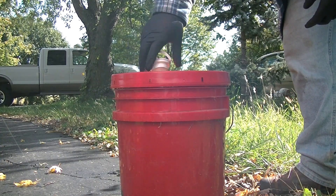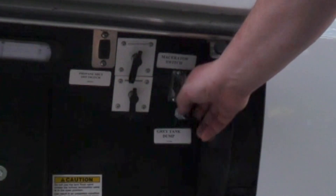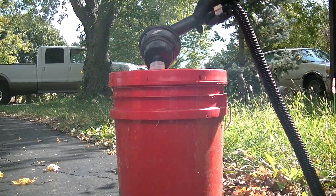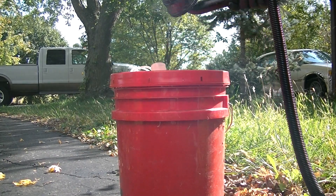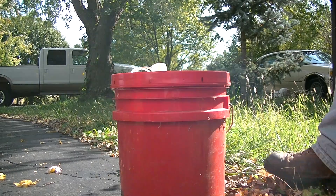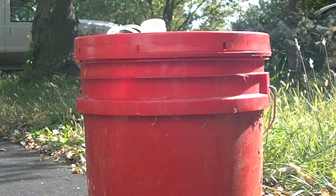The toilet is a good choice for disposal. Return the hose to the container and open the gray water valve. Once again turn on the macerator pump. This will empty the gray water tank and flush the internal sewer line and the hose. It will also help flush away any residual black water and sediment from the container. When the gray water is finished, cap the hose and the container, then drain the container into a sanitary sewer.